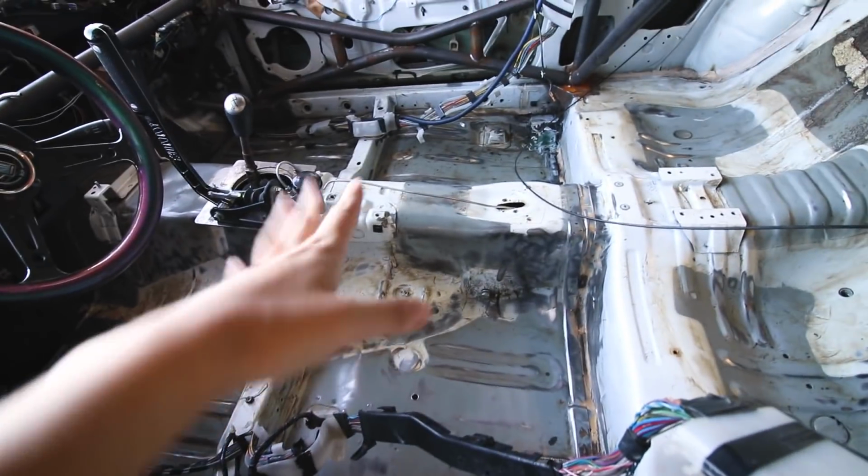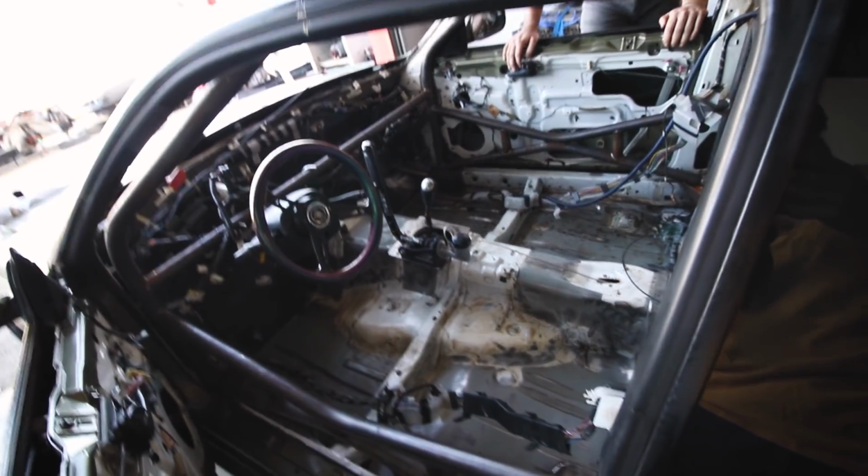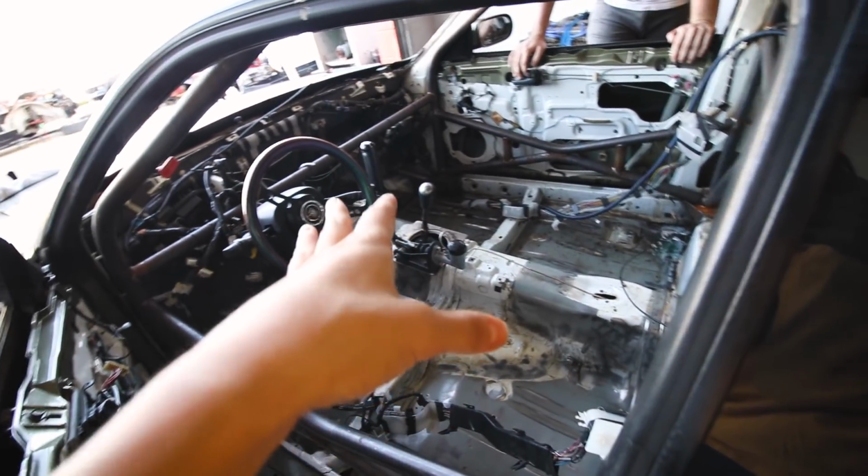We need to take lacquer thinner, kind of clean everything up, but I really just wanted to test fit the Streetfaction pieces. I know they will fit. I want to see how they look. And more importantly, I want to see what bolt holes they line up with so that I make sure I don't paint over those.